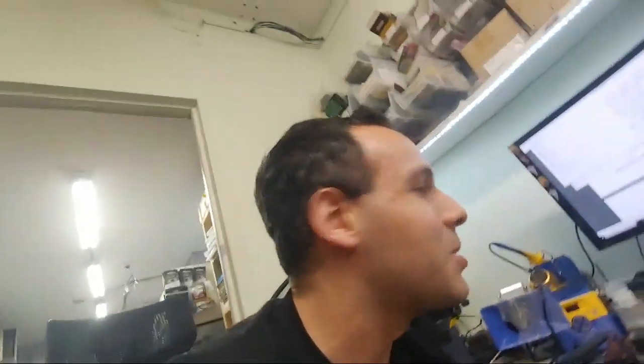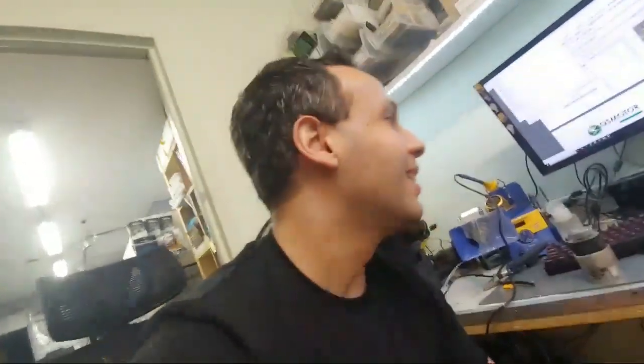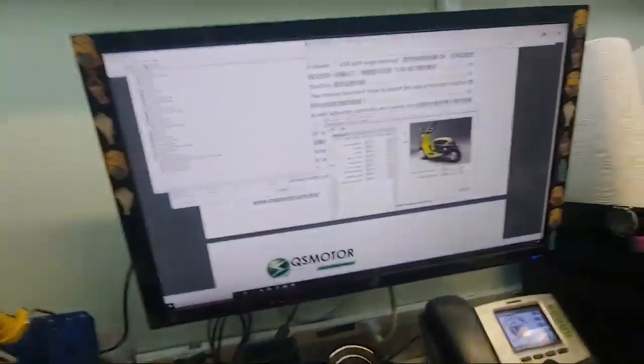Do you know how I know that? Because I sat here until 12:23 a.m. trying every single combination of hall and phase wires. So you have 3 phase wires, 3 hall sensor wires. And there's about, I think, 37 or 40 whatever possible configurations. None of them work! And this piece of shit doesn't even start.